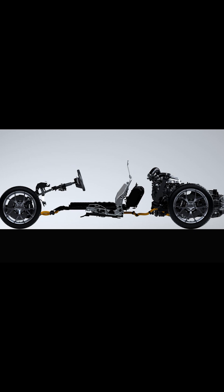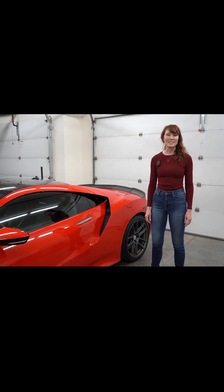In addition, because the front motors are independent, they can each send positive or negative torque to the front wheels to improve cornering speeds. This is part of the SHAWD, or Sport Hybrid All-Wheel Drive, that allows the electric motors to produce yaw when traditional all-wheel drive systems wouldn't be able to.